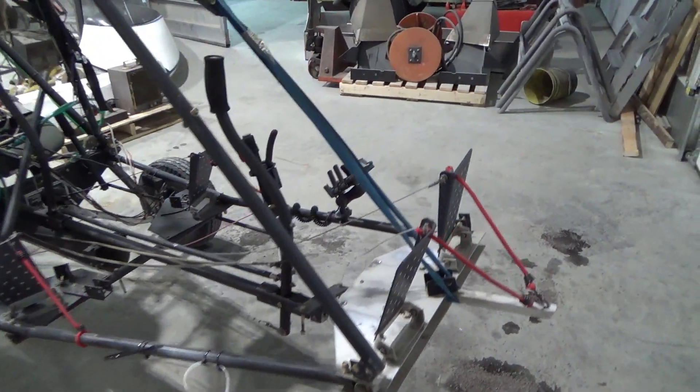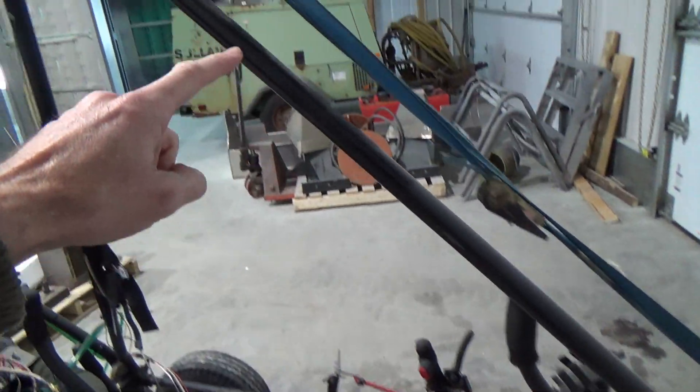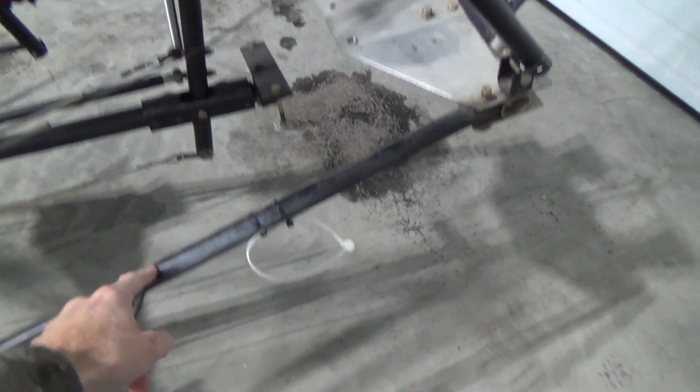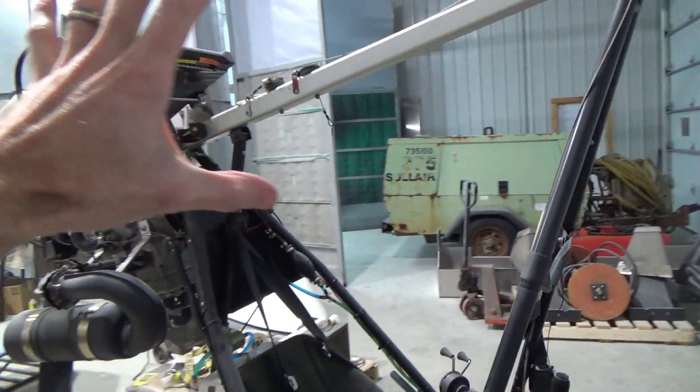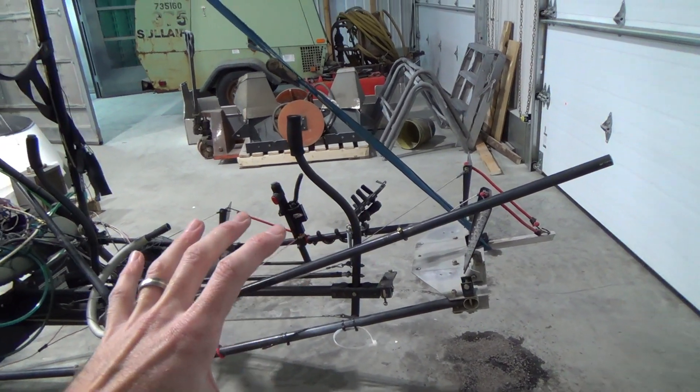So I figured I'd take advantage of that. One thing we discovered is this tube structure here goes up, comes around, and then normally goes all the way back down to the other side. What it does is support these tubes here. It supports this front part of the cabin — it's not really structural in the sense of the flying part of the airframe. That's all these back here. This tube comes down to the main point here, this one comes back up, supports the engine, supports the wings. All of the flying bits are behind here, but this does hold up the nose, which is sort of important.